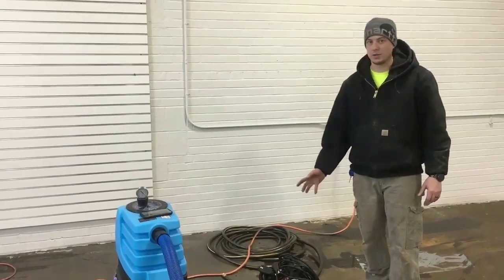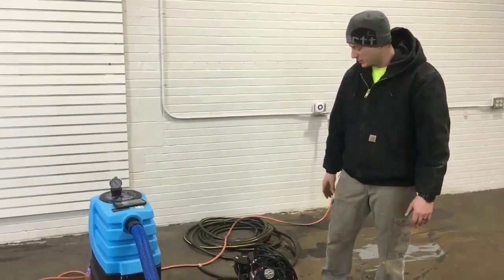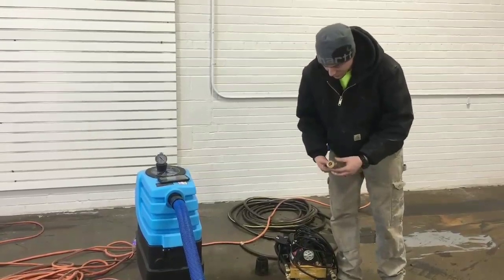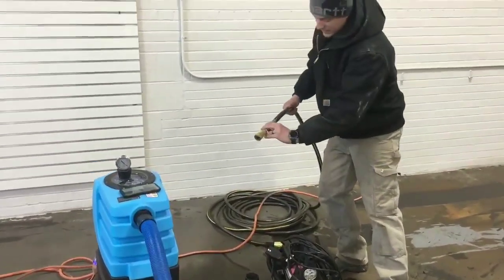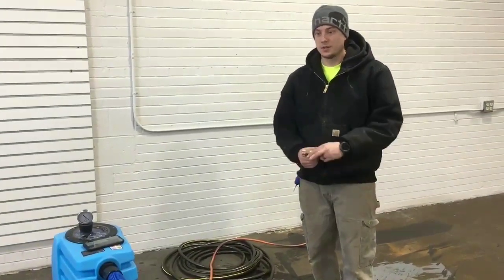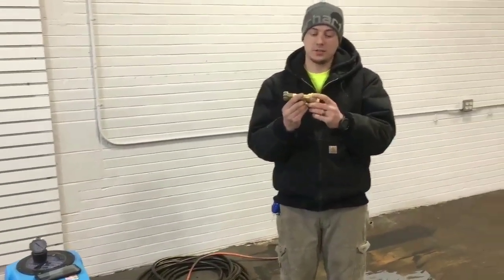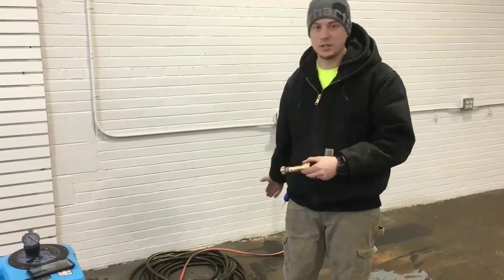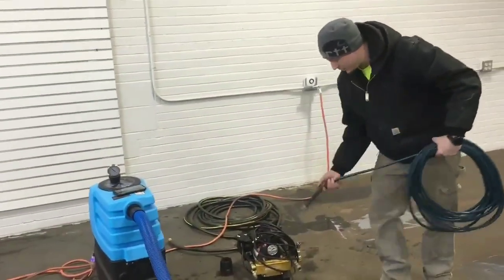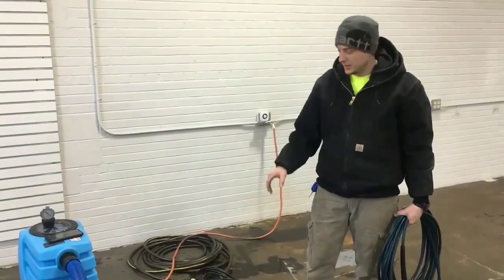This pump on its own is about 6 amps, but if you have the Water Hog it's around 12 amps — I'll double-check that. To connect the two, the vacuum hose connects right to the unit. Whether you have the Water Otter or the Water Hog, you can connect a garden hose to your inlet — I have a quick connect right here. If you get the Water Hog, it comes with a quarter-inch quick connect on the back, so you can connect a solution line directly from a source, or make a simple adapter with a few fittings from Home Depot using three-eighths to quarter-inch quick connect. Then your solution line runs to your wand, giving you 50 to 1,200 PSI.